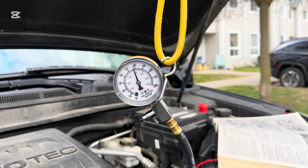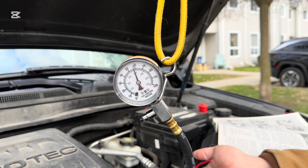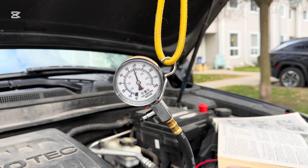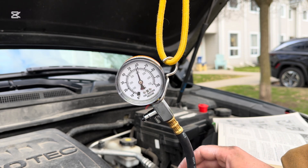Alright, so it's about five minutes gone past — we just time lapsed it to save you some time. We're still at 59 PSI. It actually rose a little bit, which is good. That means we appear not to have any leaking injectors or pumps or anything like that. If you were to have the pressure start to drop down in this leak down pressure test, that would indicate your fuel injectors might be dripping slightly and the pressure is being relieved through them, or your fuel pump might be leaking, or your fuel lines might be leaking. So you have to check accordingly, but we're all good.